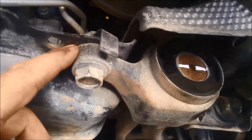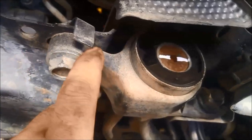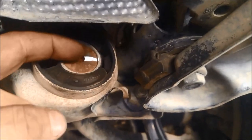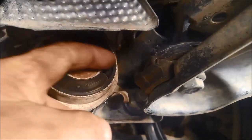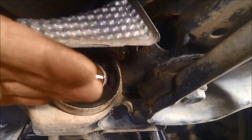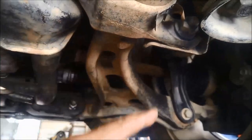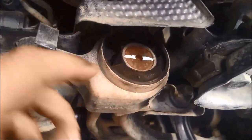What we're going to do first of all, just to minimize the effect on the wheel alignment, is put a little scrape mark there so you can see where the original one sat. I've also put a little liquid paper mark there that shows the line of it, because when we take that wishbone down it'll actually drop down, so you want to make sure it's on that angle so it's not twisting when it's running.